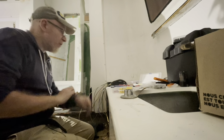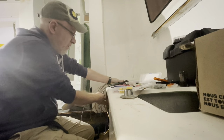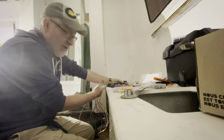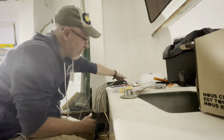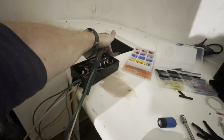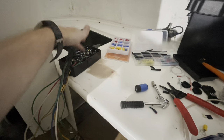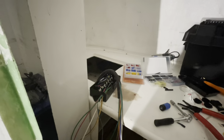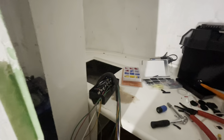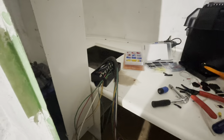I won't bore you with all of the wiring I just did, but there's my seven-way cables going to the seven-way, coming off the front. Seven-way to the front, seven-way cables coming in. This is a junction box, and then seven-way going back. The brakes I'm going to put on a separate wire going back down below, on a 10-gauge blue wire, so I'll have those in the future. Future-proofing for myself.